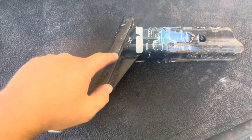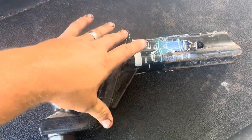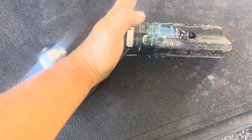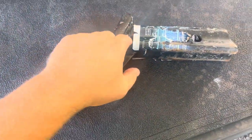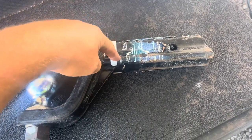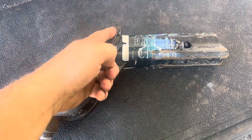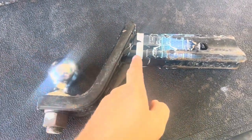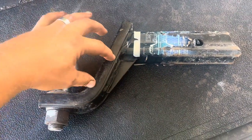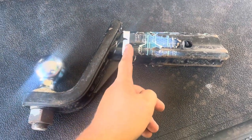If you look at a ball hitch, this section right here is a mechanical advantage point — it's going to create a twisting point when you're pulling from the ball. The longer this section is, the more force is being multiplied at the main shaft. This is going to be a class 2 lever. They always break at the bottom — even when they put a gusset in here, that just prevents bending right there, but it still puts all the stress on the main shaft.